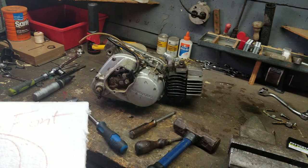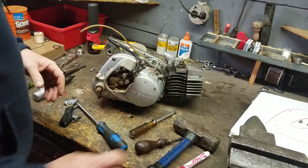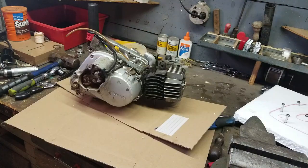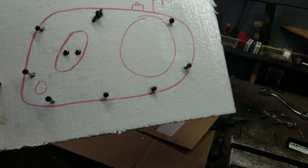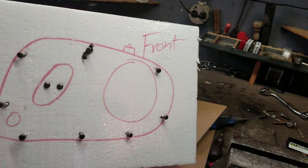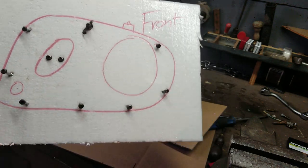And so forth. Then as I get them off, I'm going to plug them into the spot. And I've got to take off the two intake ones. Okay, so I removed all the screws and I plugged them into that water right here. Now, because there's really no measurements for all these screws, if they did get mixed up, I'm going to draw an actual template of this, measure out each screw, figure out what I need for screws, and replace them all.